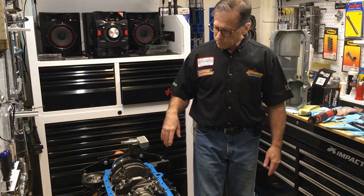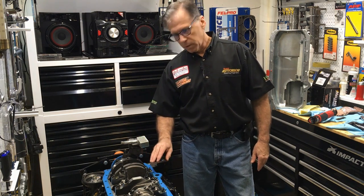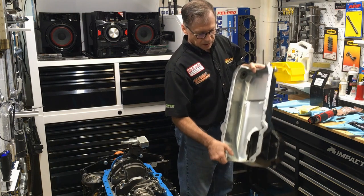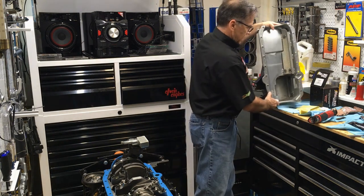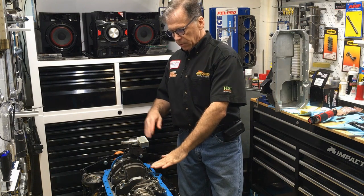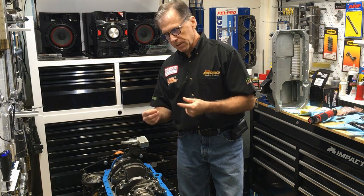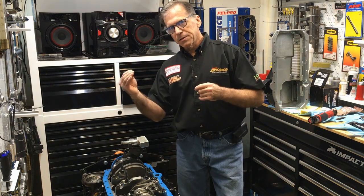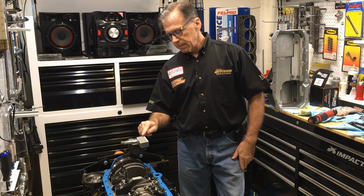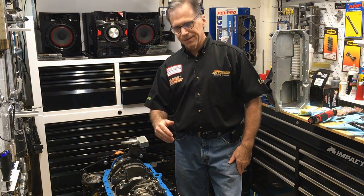So in summary, we had the pickup that I thought was going to fit on there. I put a gasket on, the one you're going to use, or this is the shop gasket. We got the pan over here. You just measure how deep the pan is to the rail. Note that in this case it was 7 and 5/16. Put that same ruler right here, lower it down to here, this with the gasket on there, take that measurement. In this case it was 7 and 1/16, so we had a 16th minus 5/16 is 4/16 or a quarter, and that's close. That'll do it, but I'd like a little bit more gap. That was a moot point because that pickup didn't fit.